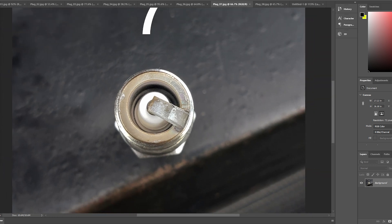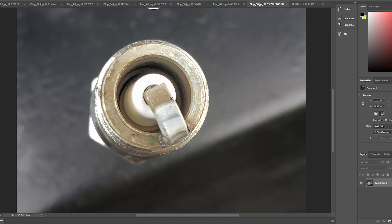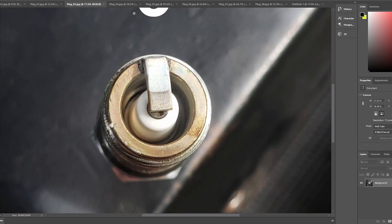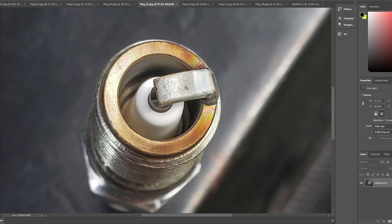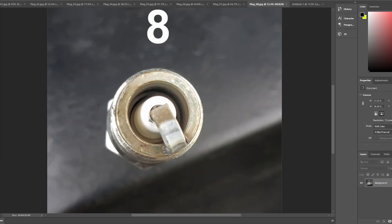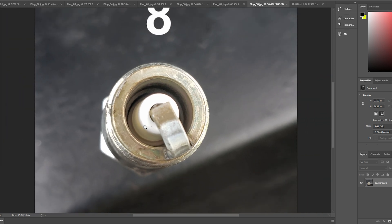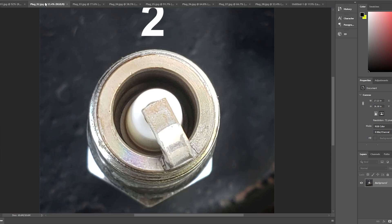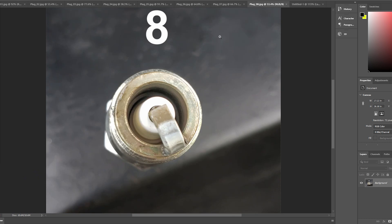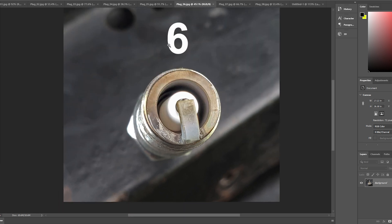Number eight is definitely a little fatter than the others — you can see it's a little darker — but I really don't see anything in this tune-up that's causing concern. I'm going to err on the side of caution and always pull a little more timing than I need. You can't just go off one plug; number five is going to be the hottest plug with the most timing advance. Overall I think the tune-up looks pretty good. I'm going to send these photos to Nitrous Express and get an expert opinion, and maybe some experts will jump in the comments.